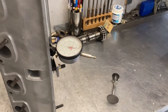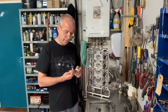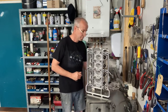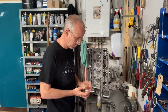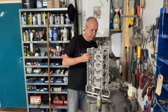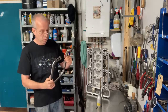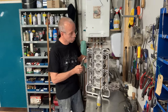It's time now to install the valve springs. Check if there are any sharp burrs on the valves and remove them so they don't damage the seals. Oil up the valve guide and put some oil on the valve, spread it nice and even, then install the valve. This is a tool I made myself — it's a little bit sturdier than the official tool, so it works a lot nicer.